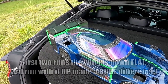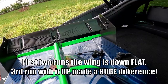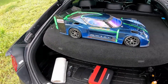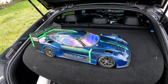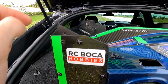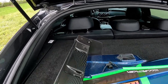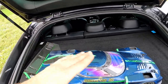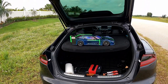If you guys haven't noticed yet, the wing is actually propped up pretty hefty. Why do we do that? I actually need downforce later on in this video, and you guys are going to see my pure excitement on how well this just flat out worked. I undid one of the screws and locked them in place as hard as I could go without stripping the bolt with the lock nut — same on the other side. It's pushed up because the rear end gets loose, and the video is going to explain the rest.